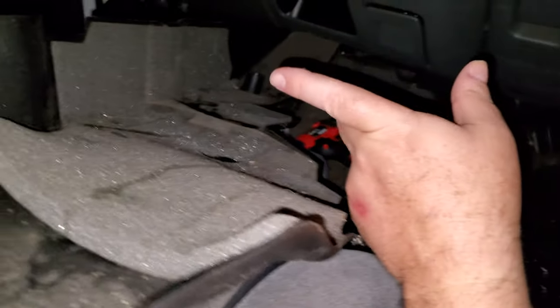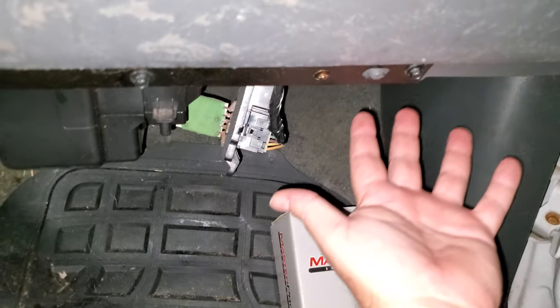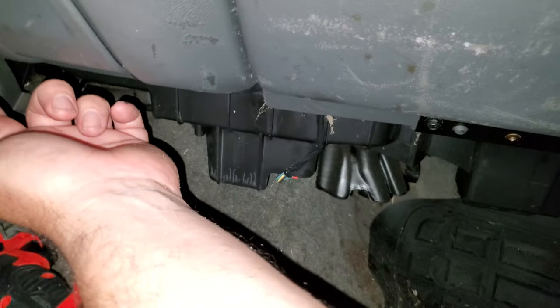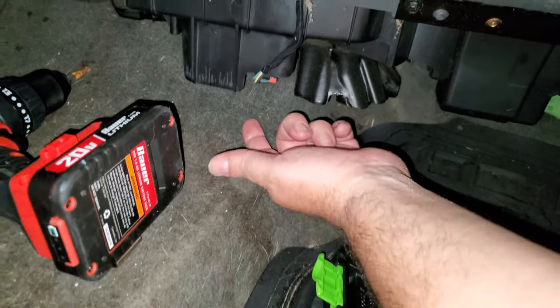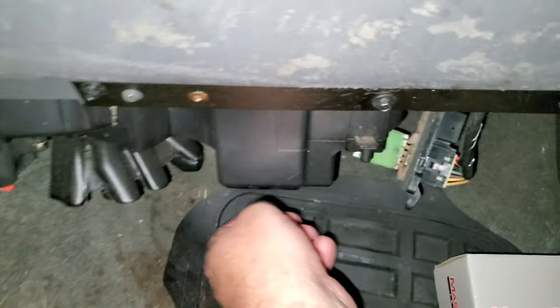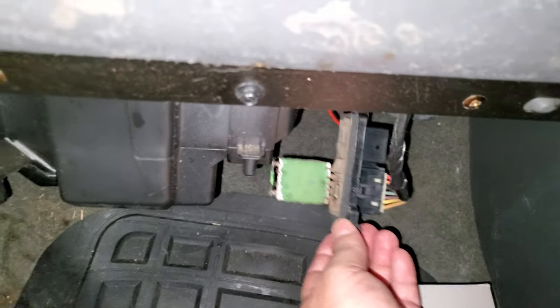Let's take a look at what's going on down here — this is what's really going on. First you got to remove your cowling, so there's four bolts. There'll be two here, one here, one over here, and another one over here. The one here is hard to get to, but I took that out, took these two out — that one you can leave in and just swing the cowling back. Then there's two bolts that hold this variable resistor or speed controller in the actual blower box. It's very simple to take this out, it's only got two screws.